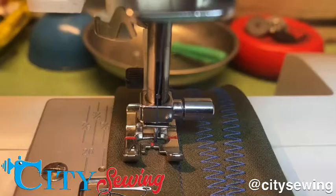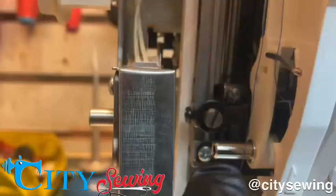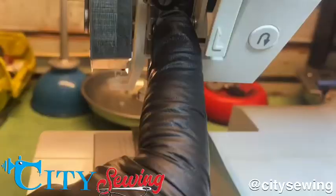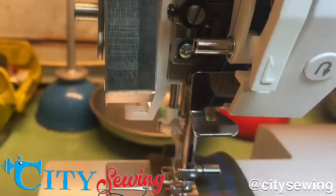So how do you fix that? How do you center your needle? Right here — this is your needle bar, and that screw you see there, every machine has it. This is what makes the needle move left, right, or center. When you make a zigzag, this part moves left to right. What you need to do is — this is an eccentric — come from the side right here and loosen up that screw.